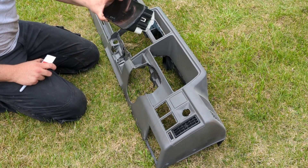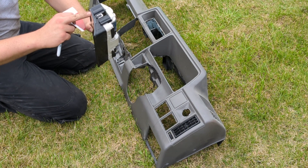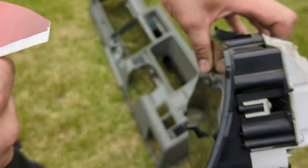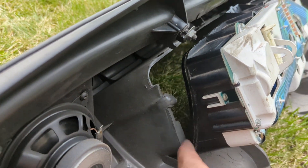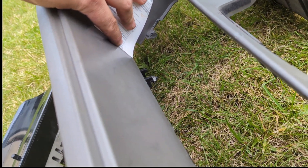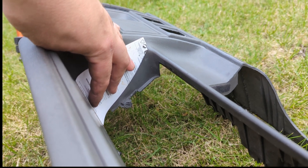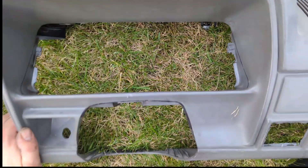We've got the dash outside on a lovely evening. I've taken a cardboard template of the speedo profile. The curve on the Astro speedo is actually more severe than the Nova one, so I need to translate this to the dashboard because at the minute it isn't even close to fitting — it's miles out and it's also catching the duct. So we need to do lots of trimming. I'm going to use the original top edge and trim the bottom edge to suit, marking it out first before cutting.